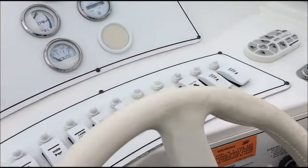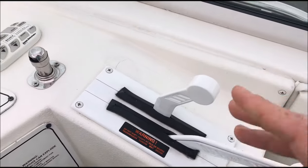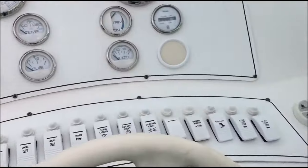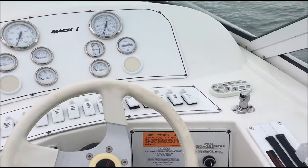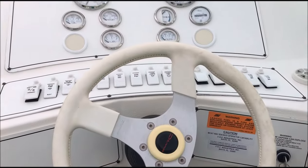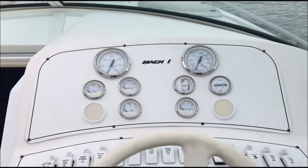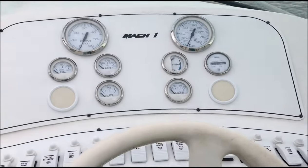Okay. Then to start it, it's fuel injected. So we just make sure our throttle's dead, make sure it's in neutral. Three things that won't start. Click, click, click, dead battery. Turn the key on, nothing happens whatsoever: either battery switches off or it's slightly in gear. There's a neutral safety switch in there. Turn the key and it just cranks and cranks and cranks and won't fire: could be out of gas or have some kind of switch down.